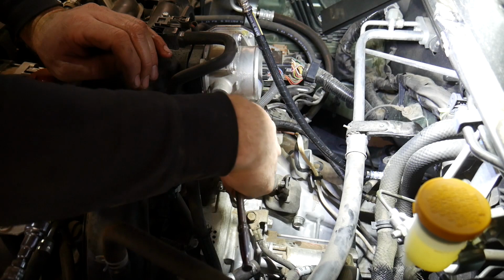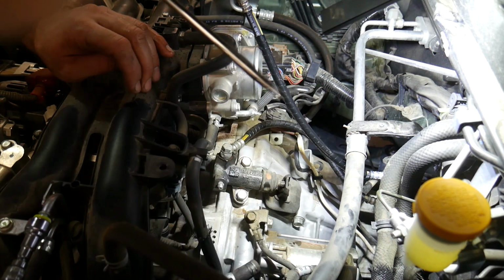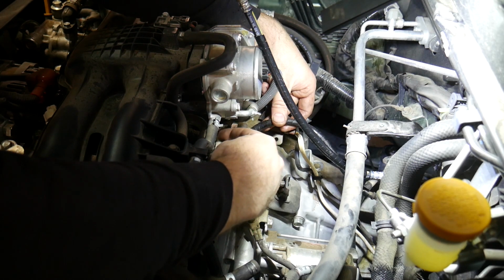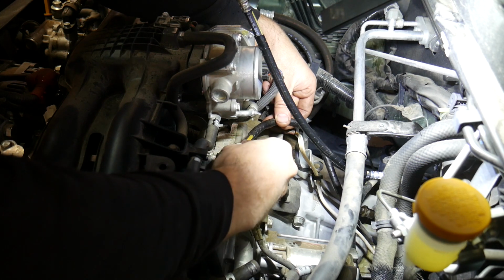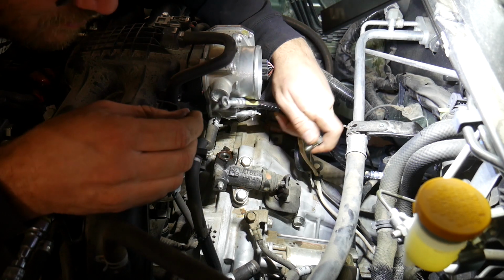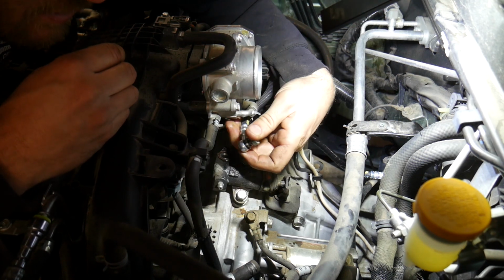And I just positioned the new line up above the throttle body. That way it's higher than the reservoir and it won't leak fluid out while I'm working on the rest of the system. So grab a 14mm socket and take the banjo bolt out of the slave cylinder, and be careful because there are 2 copper washers that seal that bolt. Now I replaced the washers with new washers from Subaru. I will put the part numbers in the description down below.